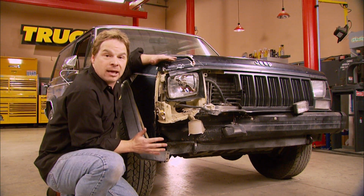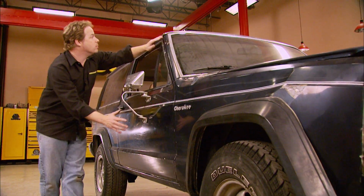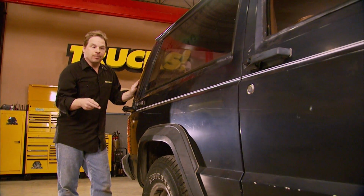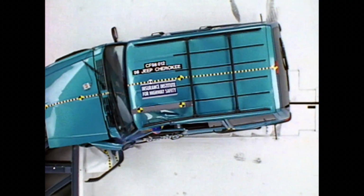Then you trace your damage back. And you carefully look and inspect as you go, checking out each panel gap and each seam, slowly working your way back to the rear of the vehicle, even if it was a front-end collision. Why go this far back? Well, check this out. Most vehicles weigh more than 3,000 pounds. That's a lot of inertia.